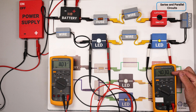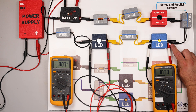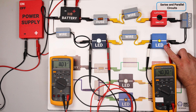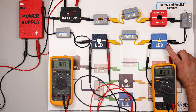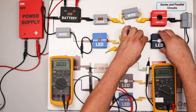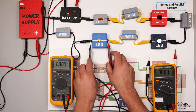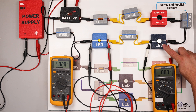The right LED is dropping about four volts — half as many as the left LED — so it has about half the resistance. Now, voltage will drop wherever resistance is highest, and the position of that resistance in the circuit is irrelevant. If I swap the two LEDs and make the same measurement, this one now reads four volts and that one reads eight volts, confirming that voltage drops wherever the resistance is greatest.